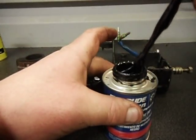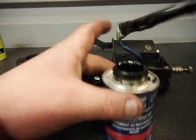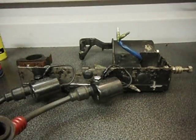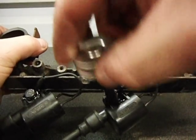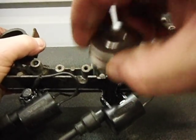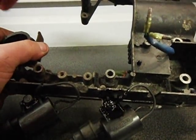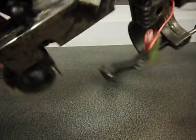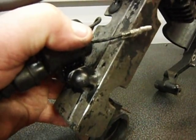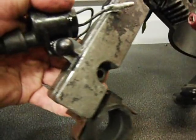Once that's done, it flashes off fairly quickly, so give it a few seconds just to evaporate off. Then open the tin of neoprene sealant, wipe any excess off the brush because you don't want it to run everywhere — you just want to put an even coat on it, not absolutely chuck it on. This goes on these fixings and you want to give it a good coat — get it in everywhere, literally coat everything. Get it in here as well. Give that a good coat, then flip it over and do the other side as well.